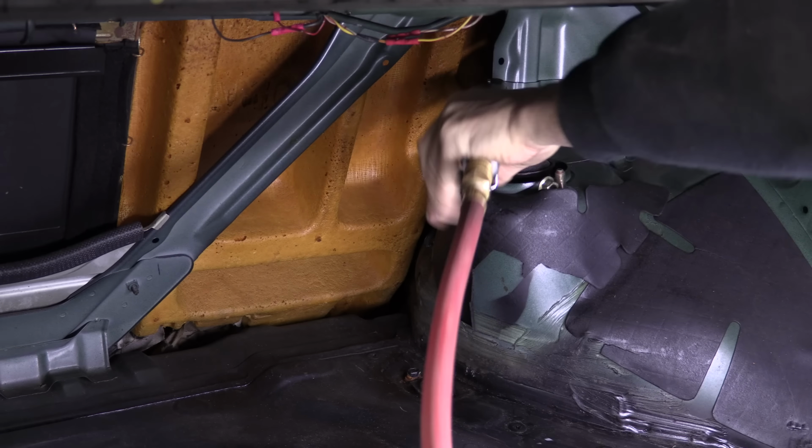Like I said, all the joints are good. Look, this one's plenty stiff. It's not moving around. I know that being too stiff can also be a problem, but this rack is just sloppy and loose. This tie rod's good and stiff, but the other one is just floppy. You know, that one's kind of loose right there. So we've got some things that we need to go through and replace.